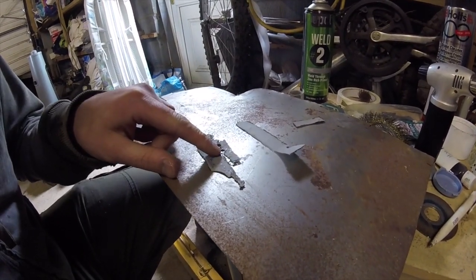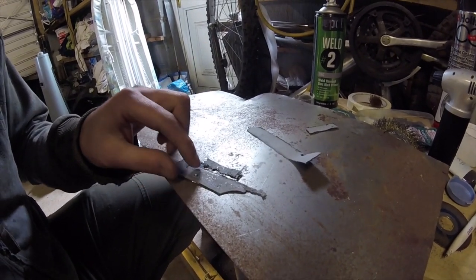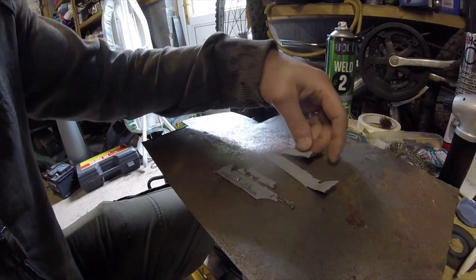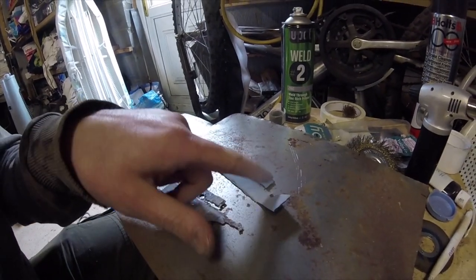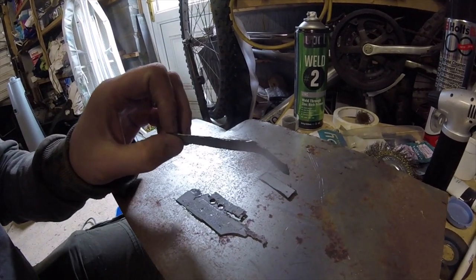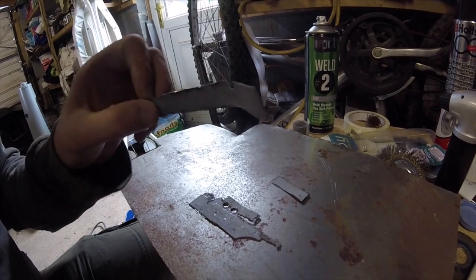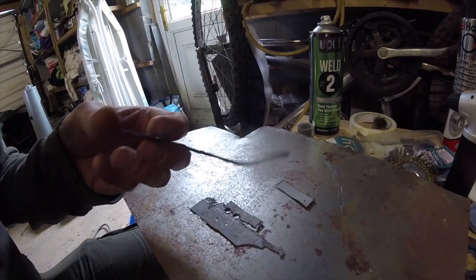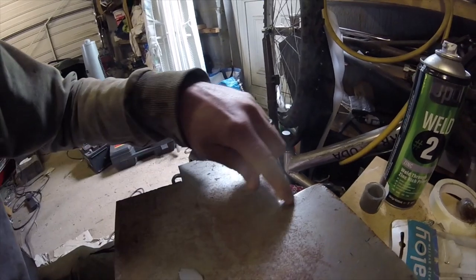Here are all the pieces I've just cut out. Obviously that piece used to have a right angle where it's actually about 100 degrees — I've just hammered it flat. That piece is the extra depth I need in that five centimeter section. Then this piece has got the little flick up on it where the shelf changes angle, so I'm going to have to flatten that to make the right size piece. But before I flatten that I've just traced along its profile here.